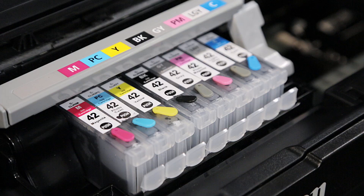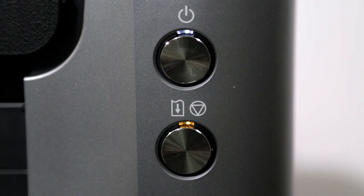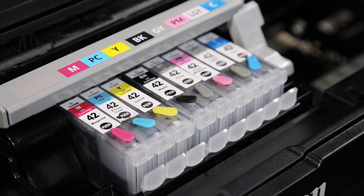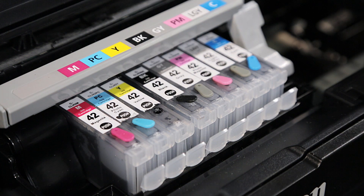generally within one milliliter of each other. Now is the time to check actual ink levels. The goal is to get the printer to a state where yellow warning lights on the printer and red cartridge lights on the printhead no longer flash or illuminate. At that time, the printer will allow the ink cartridges to be refilled and run indefinitely. This is the point that the all-black refillable system delivers its greatest value.